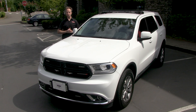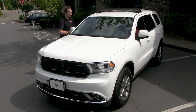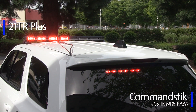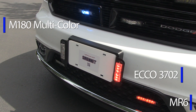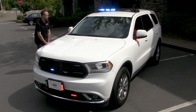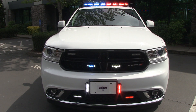We've seen the configuration and the Z3 Matrix itself in the Durango. Let's take a look at how this actually brings life into the products. We'll go through the operations of how I have my vehicle programmed. Level one is the rear of the vehicle. Level two is going to add the front of the vehicle plus some red and blue up front. And typically level three is always going to be full on red, blue, or whites — however, you can mix in whites depending on your particular state. It would also generally add in a siren tone, but I don't have mine linked to that so I don't drive everybody crazy when I'm doing a demo.